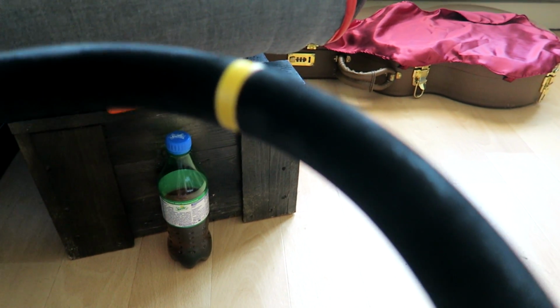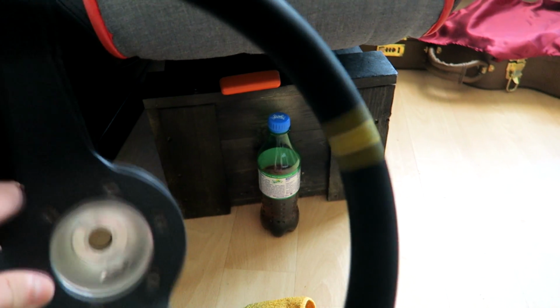That's actually grease. A lot of people think that the hairs from the suede wheel get damaged. It flats out and then it's getting shiny. What it actually is, it's getting greasy and all these hairs stick together, and then you push it down and then the grease starts to dry out and it's all stuck together.